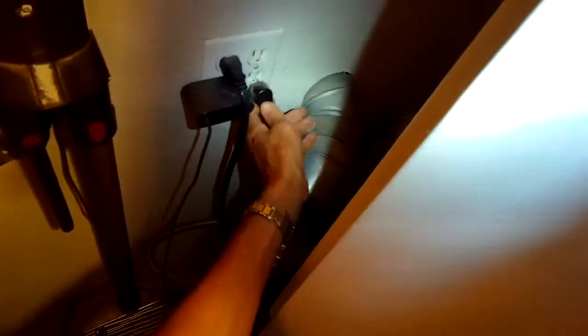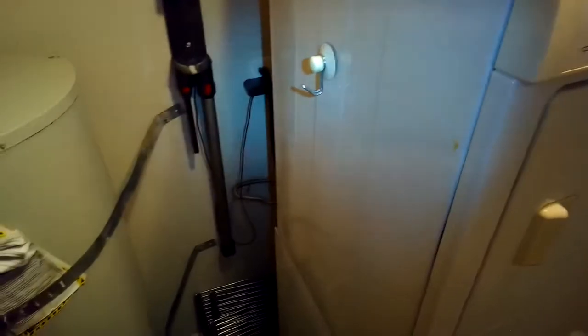We're going to close it up and push down until those click. Plug it back in and set it for time dry. Start it up — it takes a little while, maybe two or three minutes, but you should hear it click. The gas coils click and you'll feel the heat. This worked really great and we've got this dryer working like new again. I hope that's been helpful to you and you get your dryer heating up again. Thanks so much for watching — please subscribe when you get a chance.